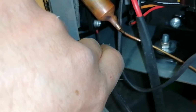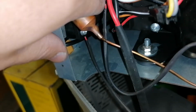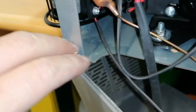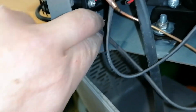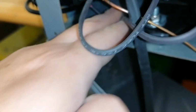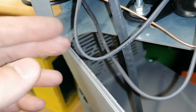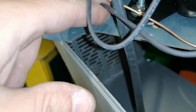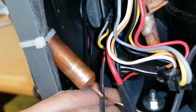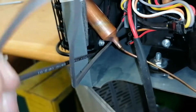It's not okay in this position. Well, clearly we need to change the fan. We cannot give it back like this. It's not all the time doing its thing. Sometimes, okay, it stopped again, now again. So let's leave it, yeah, and now the fridge stopped. Probably with F2. So there is a problem with this wire.